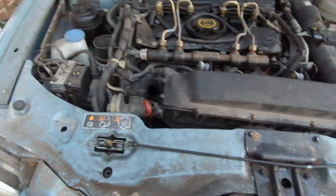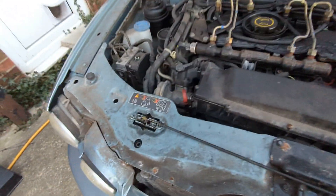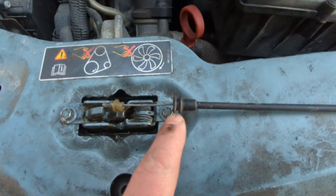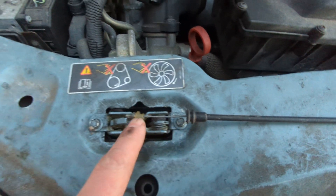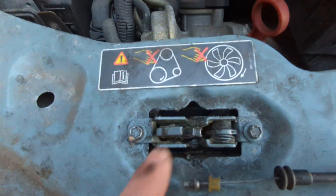The cable itself runs pretty much on top of the panel but obviously runs underneath it. It's retained by these clips on the ends of the outer part of the cable, and these little bushes fit inside the bottom of this hook here. You can see the black outer on the left-hand side there is in a hook on the latch, and to get it out you just push it downwards — you can see the little bushing is on the bottom of that latch.